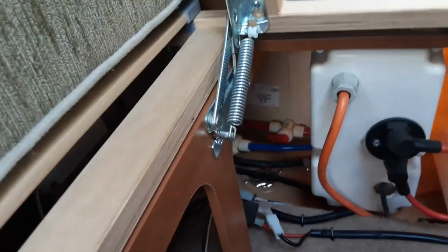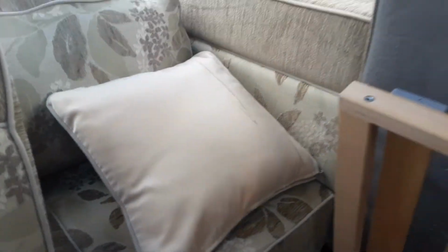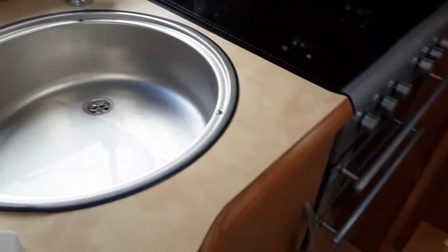You'll also need to make sure that the yellow valve, down in the corner, just there on the floor, is parallel with the floor prior to use. So once you've got those valves in position, you'll be able to fill the water system on board the caravan. So to fill it, you'd open all the taps up on the hot side of the water heating.